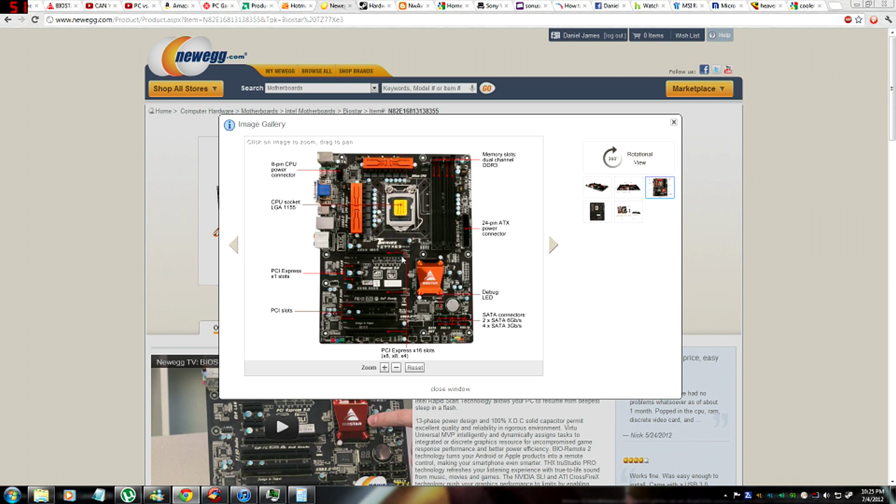So I won't really see much of a bandwidth capacity hit where the graphics cards are delivering more data than the bandwidth of the ports can handle. So even though I won't really even be running 3 cards, I'm pretty sure I am going to be running 2 cards in the near future, 2 7850s, but I don't see me running 3 cards. And obviously I'm going to have to upgrade my power supply to like a 650 watt if I'm going to upgrade to a crossfire setup.